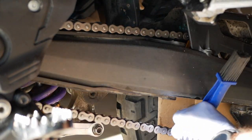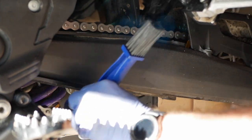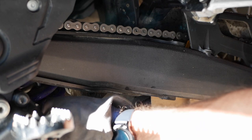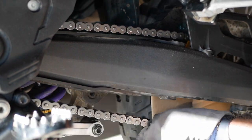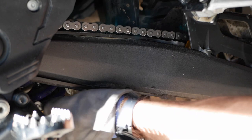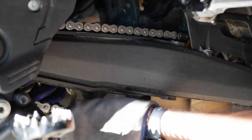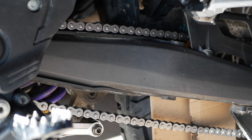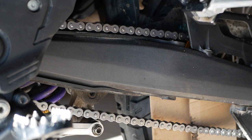Once you scrape everything off, grab a rag and dry it as much as possible to get the kerosene out of there. This chain is pretty much brand new — it has about 600 kilometers on it, so it's not really that dirty, but I was riding pretty hard on the weekend — a whole day on gravel and dirt — so the whole bike was a mess. After a trip like that it's a good idea to clean it up. Once you get it dried off, I usually like to let it sit and let the remaining kerosene evaporate.